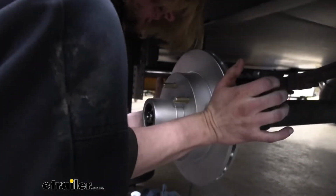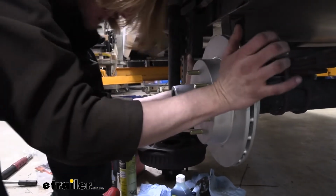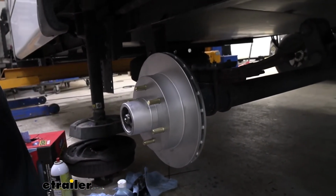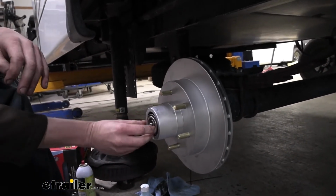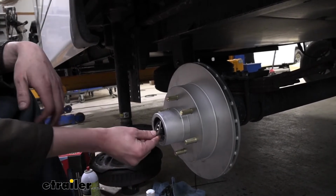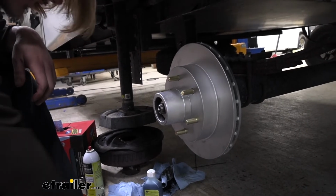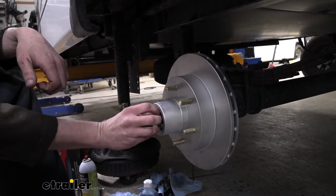And this is what we were talking about, that bearing kind of a little stiff. The newer bearings, you might have to push it up just a little bit there. Okay, now we've got that slid on. We'll take our new bearing, already got that prepared and oiled. Slide that in place. Cleaned up washer, we'll go right behind that. And then we'll take our nut here, threaded into place.